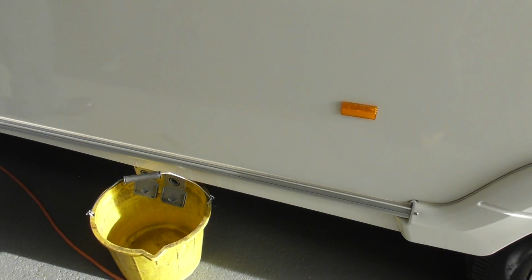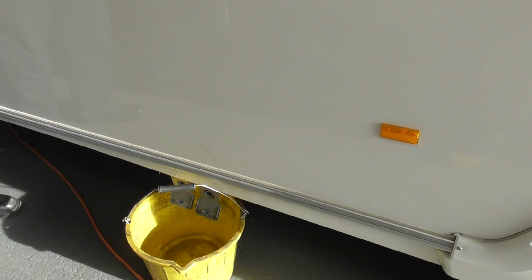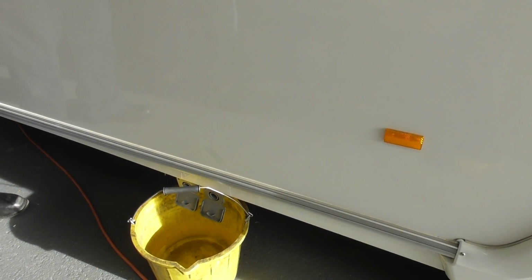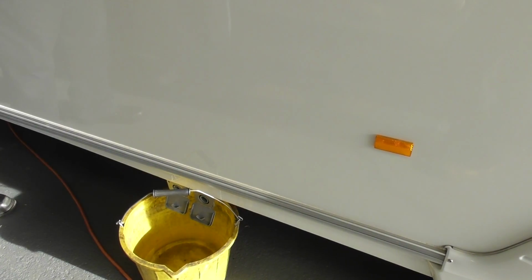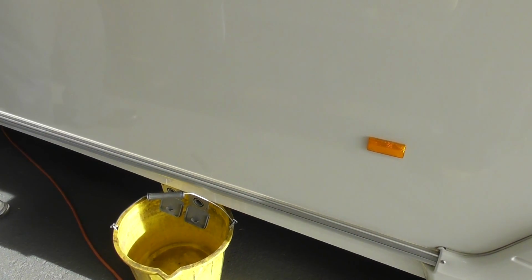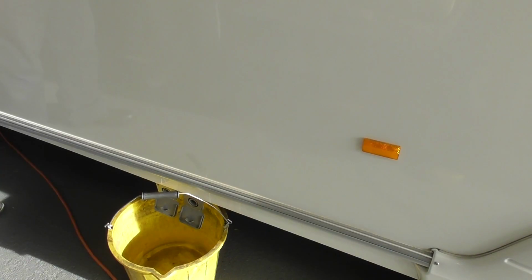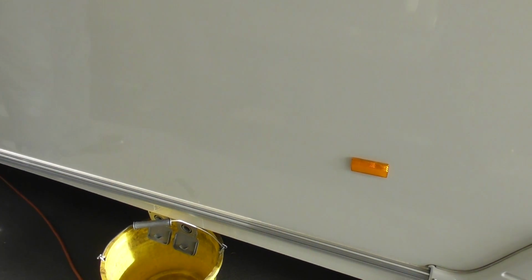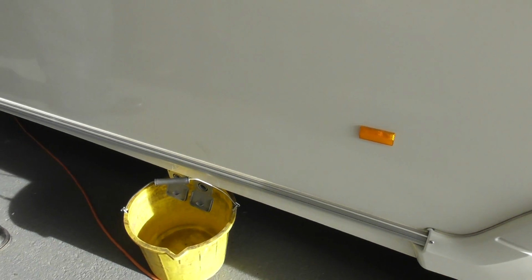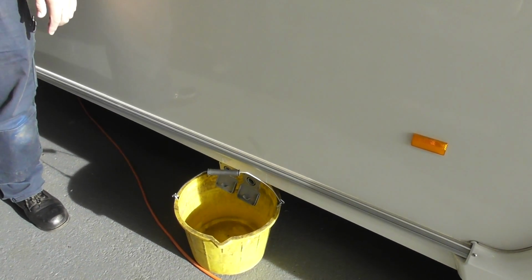So what you'll find with your waste master and your Aquaroll, the waste master's 40, the Aquaroll's 40, your waste master's about 50 litres. So what you'll find 9 out of 10 times, if you've run out of water, your waste barrel's full. Does that make any sense? So when you go into the tap, tap, shower and the sinks, you're filling up your Aquaroll and emptying your waste master at the same time.